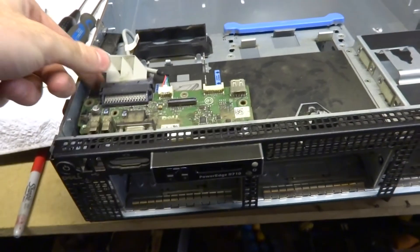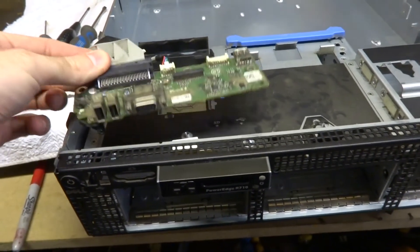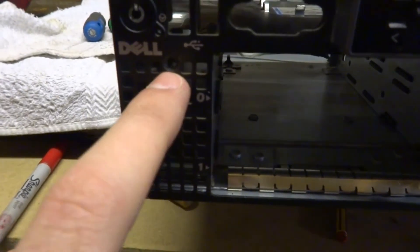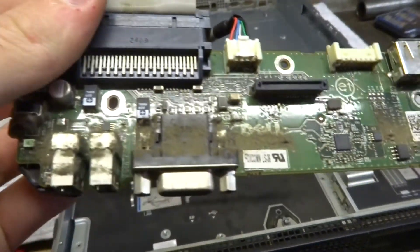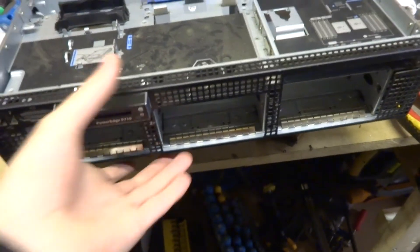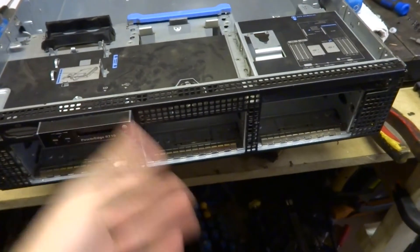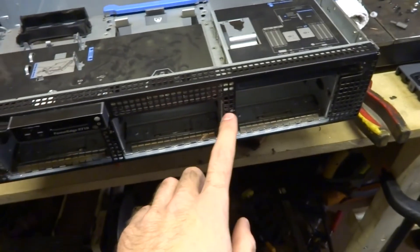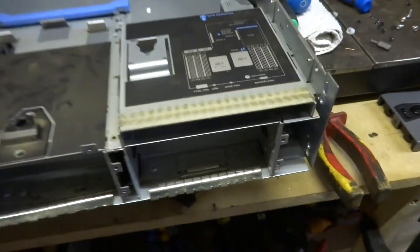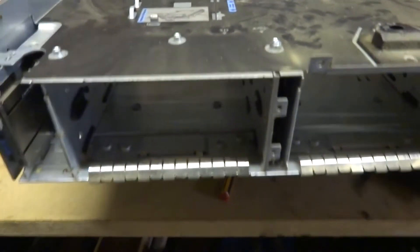The last thing to do now is to get our SAS backplane and hard drives out of the way, and then this is pretty much all open and I can start dusting it out. I am very fond of how modular everything is in this server. For this last board — the front panel connector board — there was a screw just below the L of the Dell logo, and that released it along with all the fluff. To clean the bays and the front section where all the air gets drawn in along with all the dust, I wanted to remove the front bezel. That was a load of little T8 countersunk screws, some on the bottom as well, but it was also riveted on the side, so I had to drill those out. As you can see — more dust, more crap, more of everything.